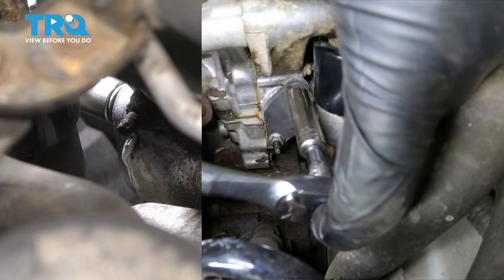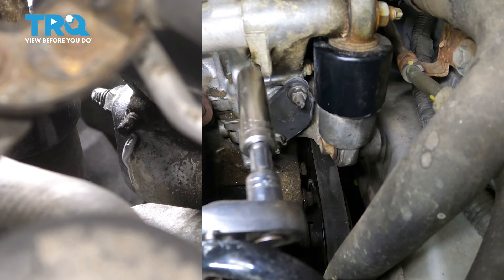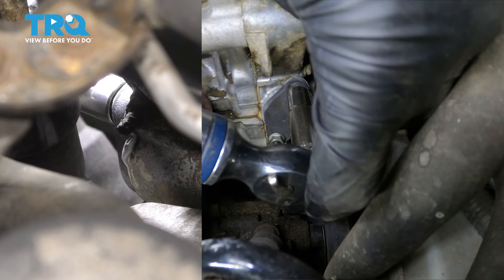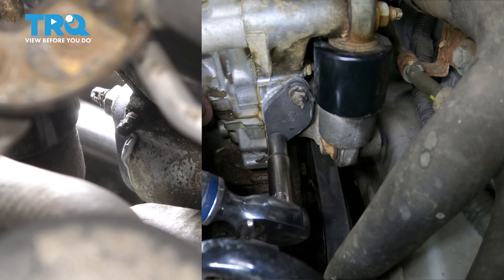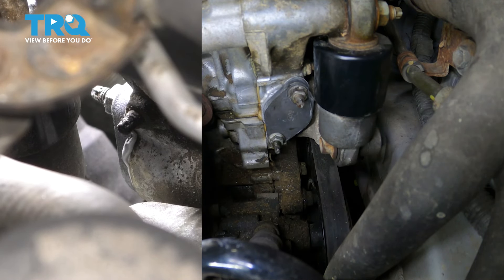Let's bottom these out — the torque for these is going to be 80 inch pounds. I'm going to go back and forth to tighten, just like I did when I loosened, for the same reason. I don't want to apply too much pressure to one stud. I want it to be even, and I want that O-ring to seat itself evenly. Don't over-tighten them — because they're small, they can break or strip out. And if you under-tighten it, it could potentially leak, or the tensioner could fly out with the engine running, causing catastrophic damage. Both are torqued to spec.